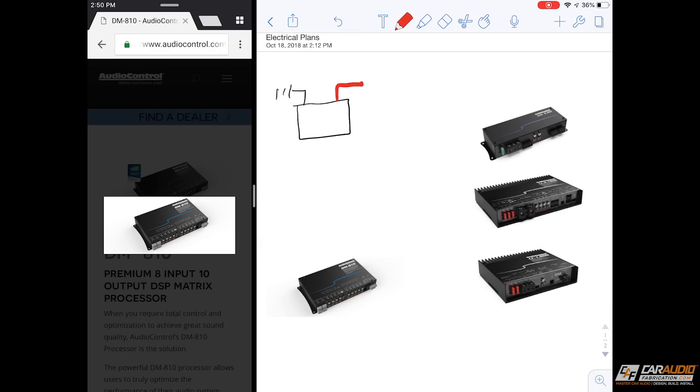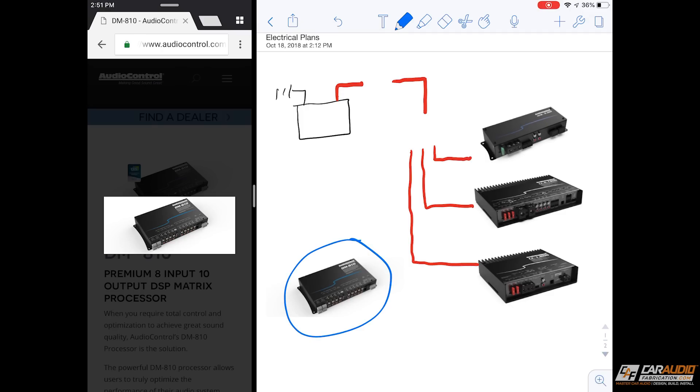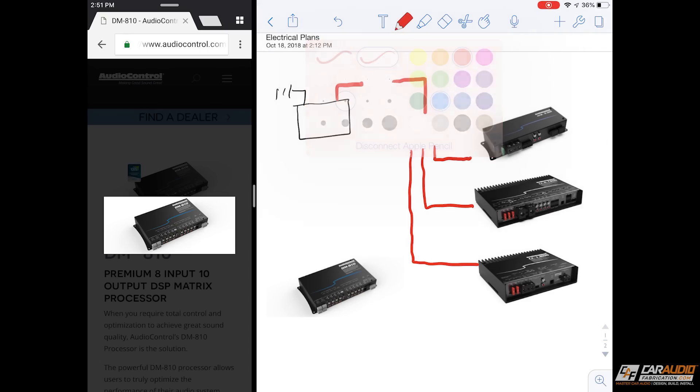We know that we're going to come out of the battery and then we need a fuse, so I'll leave a space there. Then we come out of the fuse and go down, and I need to divide this wire up — so we're going to have a distribution block. Out of the distribution block we're going to go into each of the three different amplifiers with our power. We also have things like the DSP, maybe some lights and other stuff, so I want a power feed for those as well, coming out of the distribution block over to a smaller fuse distribution block.